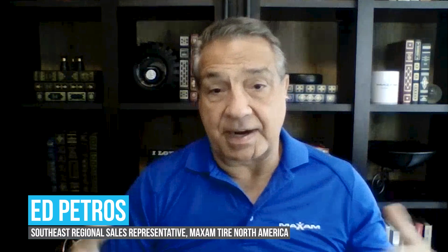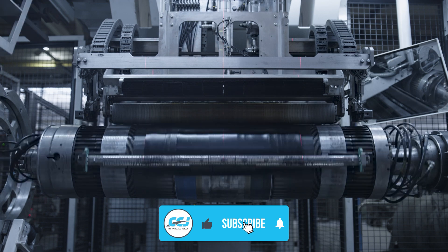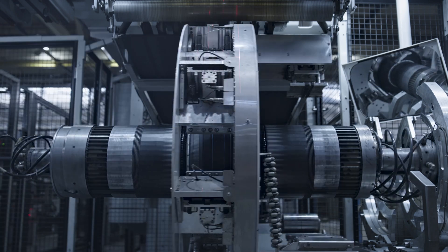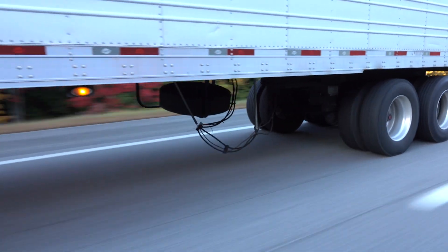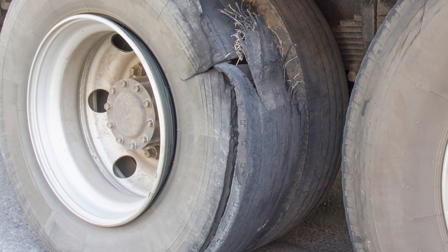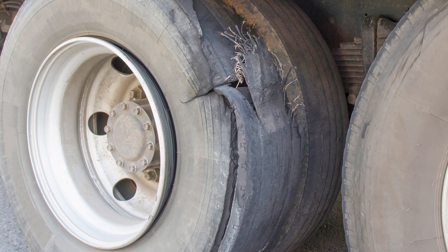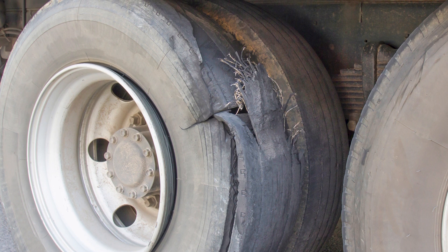Basically, a tire is a modern marvel. It's put together with steel and rubber — everything is molded together. There's no glue sticking the tire together; it's just getting the components to bond. And the ultimate enemy of a tire is heat. If you think of the steel cables in a tire like a paper clip, and you bend the paper clip back and forth enough, you weaken it and it will snap. That's where you get a zippering effect on the cords, and you also build up heat internally in the tire, causing components to separate — the steel tread plies, body cables, and different rubber compounds.